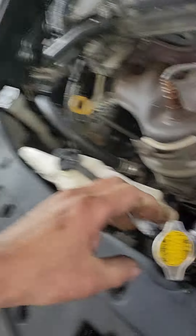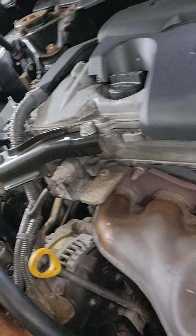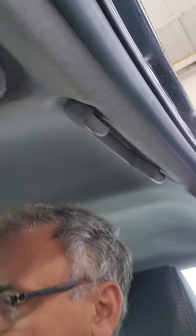There's a little bit of pressure in here, so let's just see what we get. I don't advise you at home doing this — she's hot. So let's get this off. The hose here is hot and the lower hose is cold. When your cooling system is complete, you will have heat in your heater core and it'll be plenty hot. Your upper and lower radiator hoses will be hot — not warm to the touch, they will be hot.